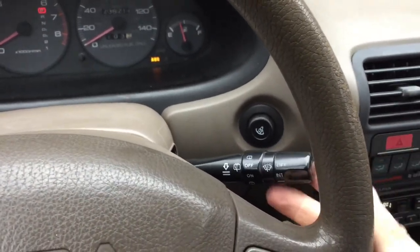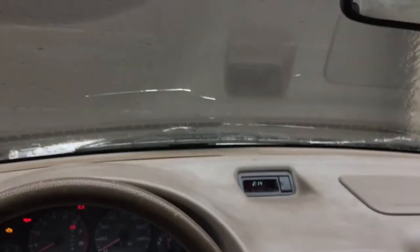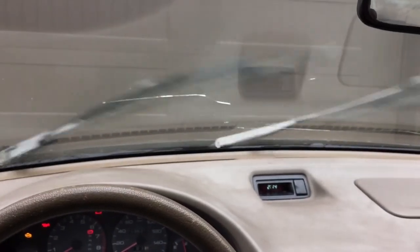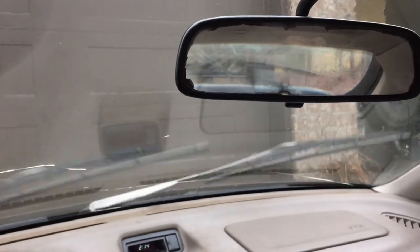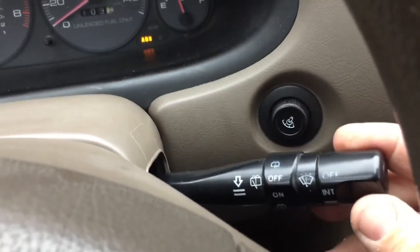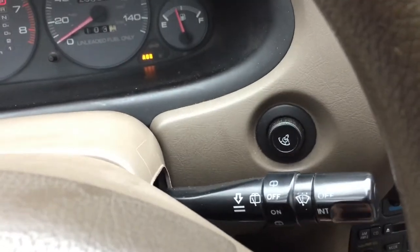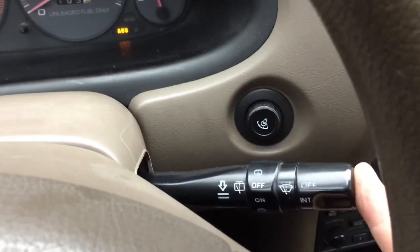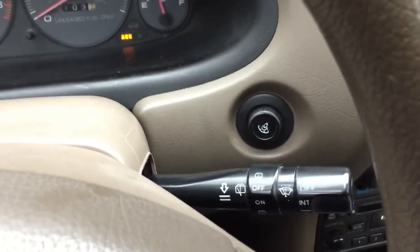We're back in the car now, switch is installed. I don't have the squirts and I don't have the high wiper function, but I do get intermittent and a second speed that's a little faster, and I can also get the rear windshield wiper. So I've got enough to function and keep me safe. The moral of the story is: if yours is bouncing around and you want to fix it and keep all the functions, don't break any pins — just fill your hole with something that'll keep it from moving.